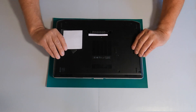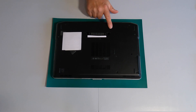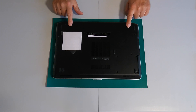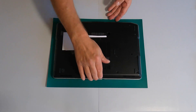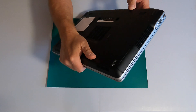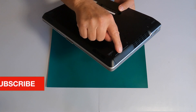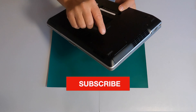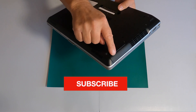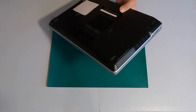All we're going to do is flip it over. The steps are: we're going to go ahead and remove the battery — there are two clips here, we'll slide them aside and pull the battery out. Then you can see this bracket, which is where the hard disk drive is stored inside the device. There's a single screw on this bracket attaching itself to the hard disk drive, making it easy to slide in and out.